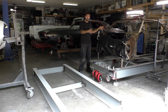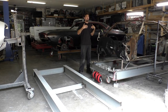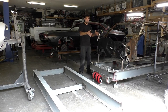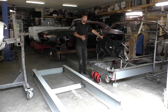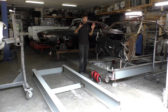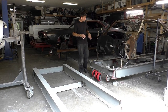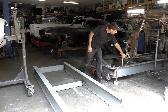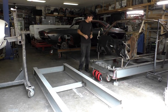When we cut them apart this much, it also makes it a little bit easier and time-efficient when we put it back together, so we're not cutting off a small piece, finishing that, and then moving on. You could see we actually got half the parts for the Firebird project yesterday, and getting excited about some parts, I decided to throw the Dynacorn firewall in place. You could see it was jigged up, with these little pinholes coming in through the side, so I was able to just kind of set this firewall in place.